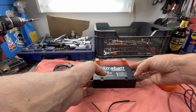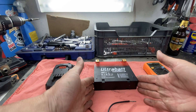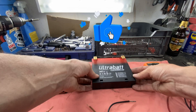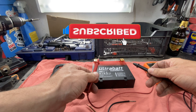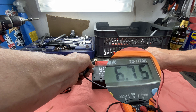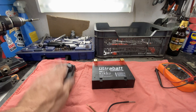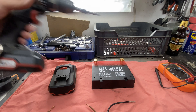So this is my battery — it's been drained even though it's been on the charger. I don't know why that happens; I think that's probably my charger. The battery is now at a low level where I can't do anything with it. We can just check that with the multimeter — it's 6.75 volts. What we're gonna need is a lithium battery from a power tool.